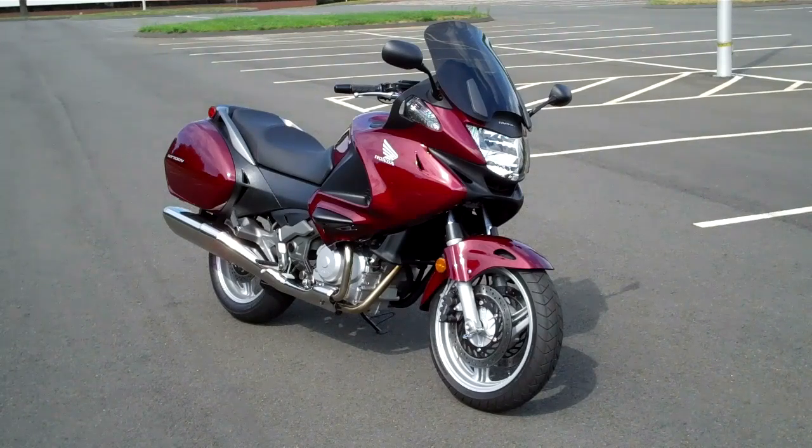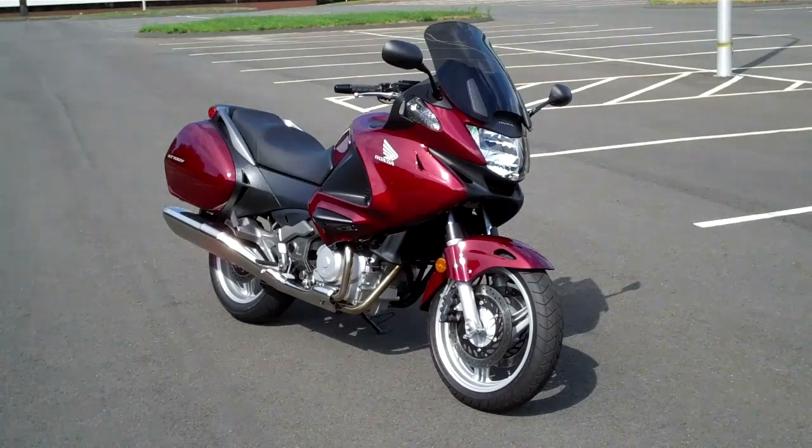One being that if you had the wind deflector kit on your Honda and the windshield was in the full down position, the leading edge of the windshield would bump into the mirror mounts just a little bit. Also, the radius was off just slightly, and what that would do is when you tighten the windshield down to the mounts of the motorcycle, it put a little bit of stress and strain on the mechanism that moves the windshield vertically, and we found out that it kind of bound up the system just a little bit. But all those situations have been completely revised, and a few more to boot with the new generation, and we're going to show you that right now.